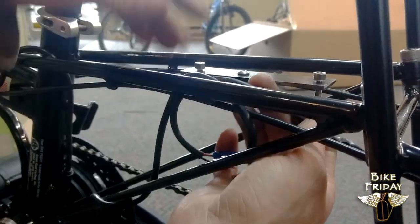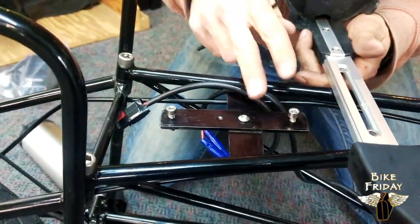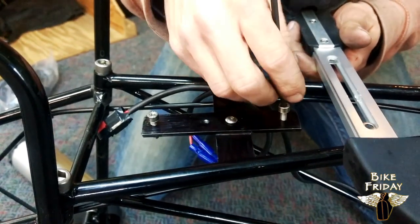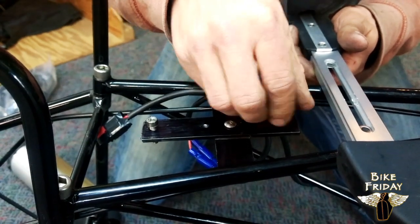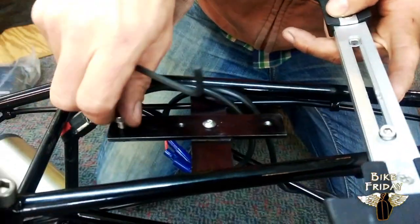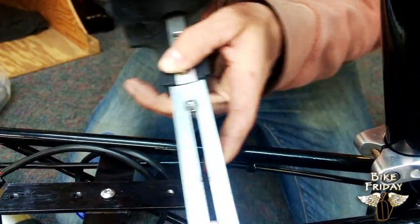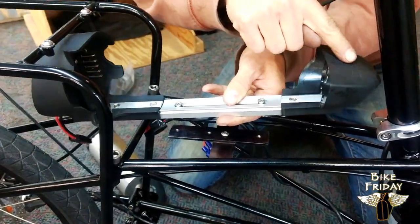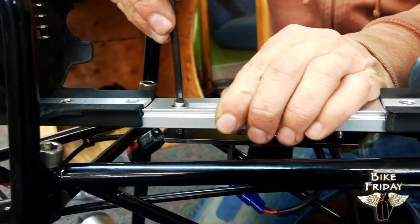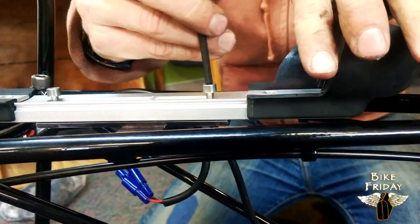Now we're going to keep it out of the way and go ahead and mount the battery plate to the frame. This particular bike is actually a prototype, so that extra bolt is only on my bike — more likely than not, you just have the two bolts front and back on this plate. Those are the ones we're going to use to mount this battery cartridge plate adapter. Notice that there are some washers embedded in there — that's where these bolts are going to go. The end with the key goes towards the front, and the end with the electrical connections goes at the back. Line those up with the threaded holes, careful not to cross thread, get them started but keep them loose. That's going to fit nicely right there. We'll go ahead and tighten the bolts down fully.